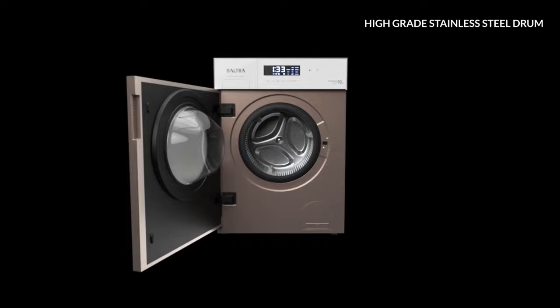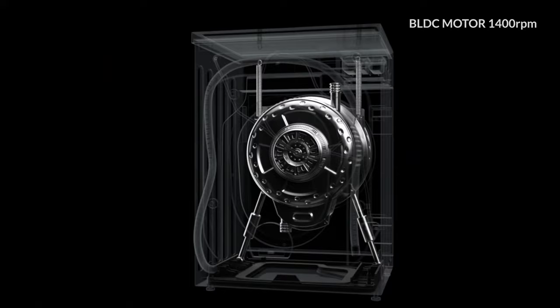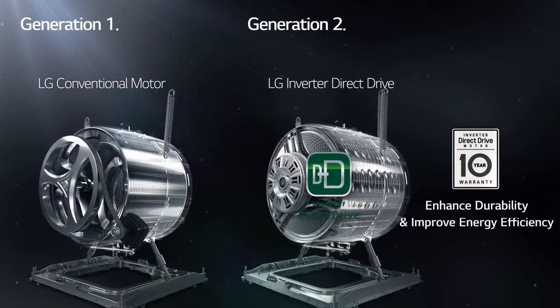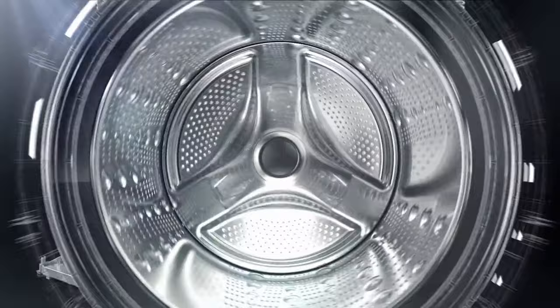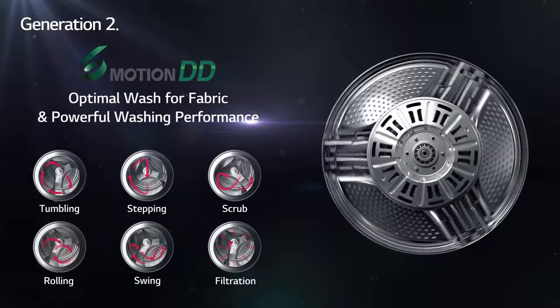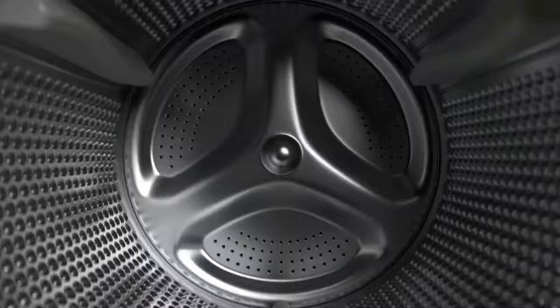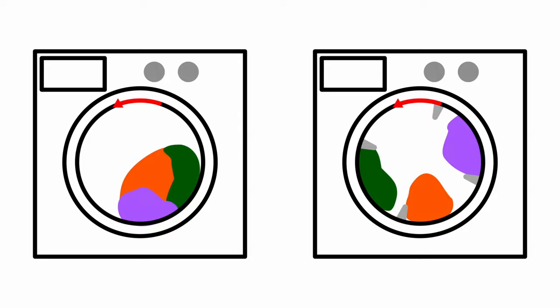Within the watertight drum, there is another drum which has holes all over and is capable of rotating — this is where your clothes are actually placed. A motor is needed to spin this drum, sometimes directly on the drum or connected via a belt system. During the washing phase, the drum rotates in one direction then the other to ensure maximum agitation of the load. Depending on the user inputs, the computer can cause the motor to spin faster for heavy loads or slower for more delicate items. The drum also has several fins around the circumference to act as agitators so that the clothes don't clump together when spinning, allowing every surface of clothing to be exposed to soap and to rub against one another to get rid of those persistent stains.